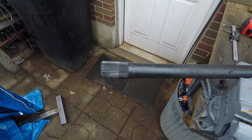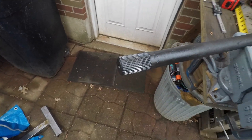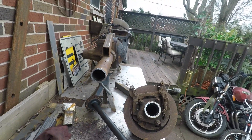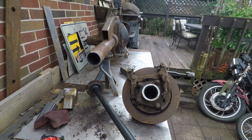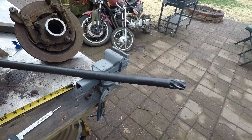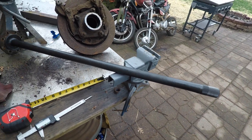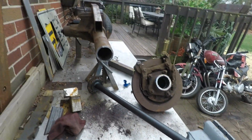What I'm going to do is probably cut this shaft off about here just to use the splines. I'm going to make myself an indexer using the original splines and a cutter. Jantz Engineering on YouTube has this setup — I'm just going to mimic what he's done, because I'm a cheap bastard. I really don't feel like paying $400 for a set of custom inner axles. I'd rather buy a bunch of Dana 50 long sides or even Dana 60 long sides for a '99 to '04 Super Duty axle and just cut them down myself. If I get them the same length, I can keep one spare laying around and it would work for both sides for the rear steer.